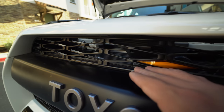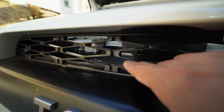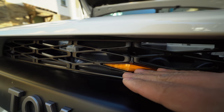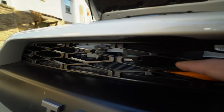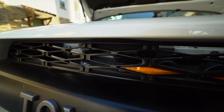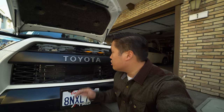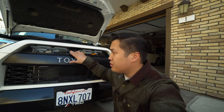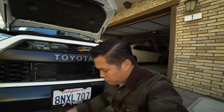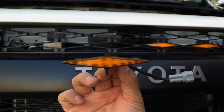Not every row is the same. Where these two are, you'll notice there's a groove above and below where this marker goes in. In the row above that — which is actually the center line of this grille — these are larger openings and they don't have that groove. I originally wanted to put three lights instead of four, because the gear begging guy commented that three lights is more official due to dot requirements. But I found these won't fit in those positions because they have that little tab above and below the marker which is supposed to fit into the grooves, and it just doesn't work.